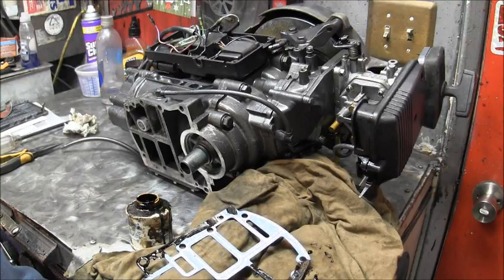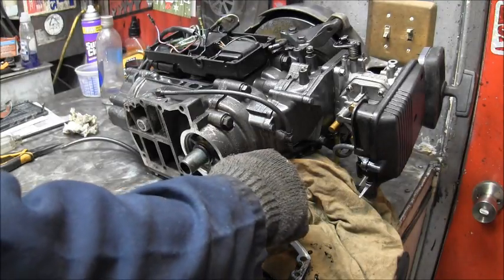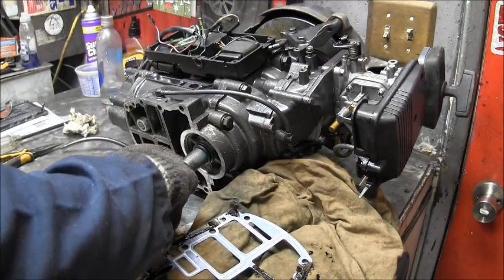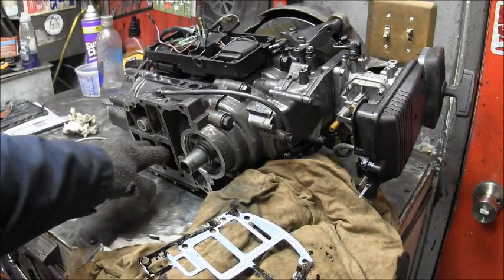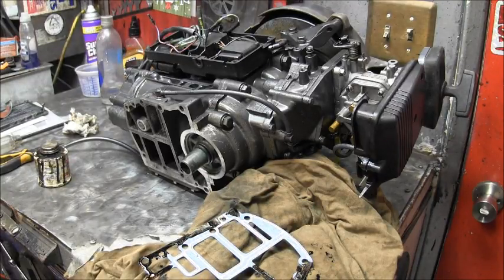I'm going to put it there and then let it dry for half an hour or so, because when you're putting these power heads down there, if you ain't got a hoist and all that good stuff, you tend to scoot these gaskets around. So wherever there ain't no white, I'm just gonna put a little stickum there to help it stick on there. But yeah, you want to scrape all this mess off with the power head kind of in that position, where your exhaust ports for your lower cylinder and your piston up in there don't get no yuck in there. So clean that up real good. Now, let's go over here and look at this.